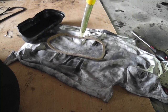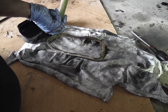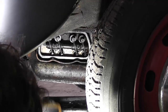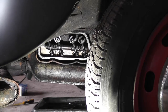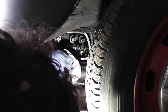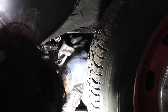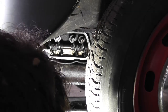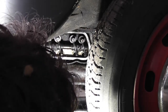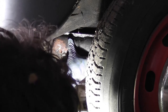Wipe up around the sealing surface. These seals, like the strainer gaskets, should be soaked in oil — they need a good bit of oil on them otherwise they will not seal. Trying to keep oil inside a VW engine is a mystery — you have 8 pushrod tubes with 2 seals on each end, so that's 16 seals; an oil cooler with 4 seals, so 20 seals total; the oil slinger on the back; the crankshaft oil seal on the front; and the sump plate as well. All those things mean you have plenty of places for oil to leak from.